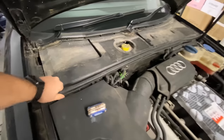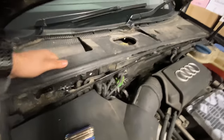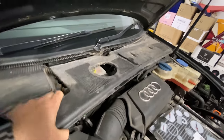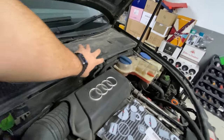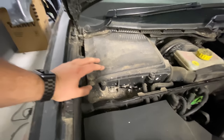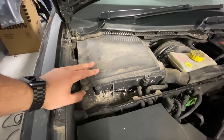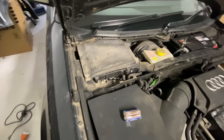It should be situated under here, so you've got to remove this — it seems to come off all the time nowadays to get under there. Then the cover for your plastics as well, it pops out. I should probably put the battery on a trickle charge to be honest, that would make more sense. Then this here is your cabin filter. So what I'm going to do is take off the Torx bits — I bet it's a T25, which is always one I can't find. I'll give that a crack, change that up, and crack on with some more stuff.